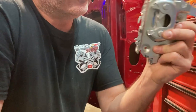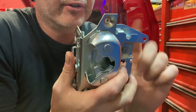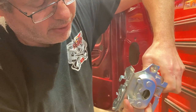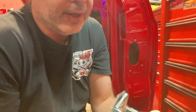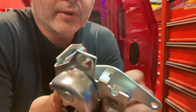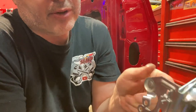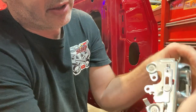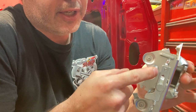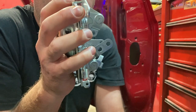Let's have a look at what all the functions are on this latch. When the door latches, that's what happens. This one here is gonna have a rod that goes up to your outside door handle — the button — and that's what unlatches the door. And this guy right here has two rods: one's gonna go up to your lock, I can't remember what the other one goes to off the top of my head. And then there's this one on this side — this is your inside rod for your door handle to unlatch the door. You can see the mechanism right here, it'll slide down and unlatch. So: inside door handle, outside door handle or button, and this is our locking mechanism.